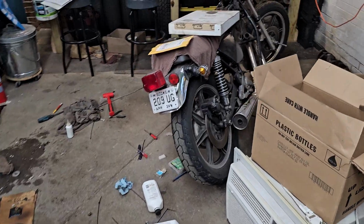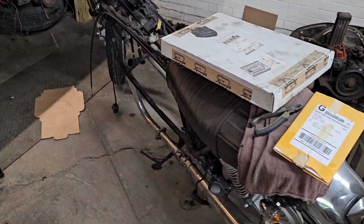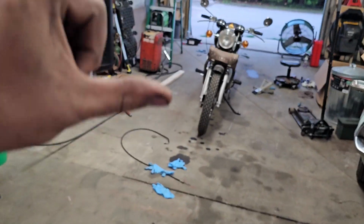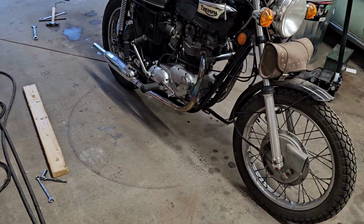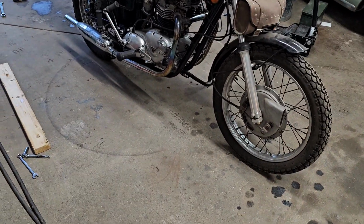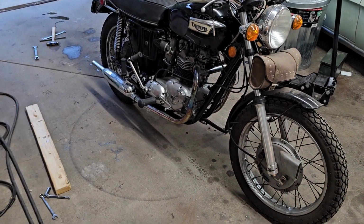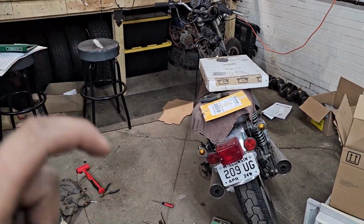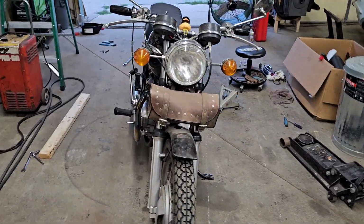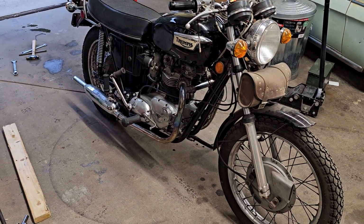All the Japanese bikes run the constant velocity carburetors with the vacuum diaphragms, and like on my XS 750 before I crashed it, you could just open it right up and it would just take off. Whereas this is just a throttle slide. It's just a door that slides up and down, and the needle is on that. So it's much more mechanical. I would liken it to mechanical secondaries on a 4-cylinder. If I stomp on this, the needle for the metering jet goes all the way up right away. Whereas on a constant velocity carburetor, I just open the throttle and that needle moves with the vacuum diaphragm. So I'm assuming it is behaving like a mechanical secondary, like a double pumper or something like that, in which case it would be normal operation.